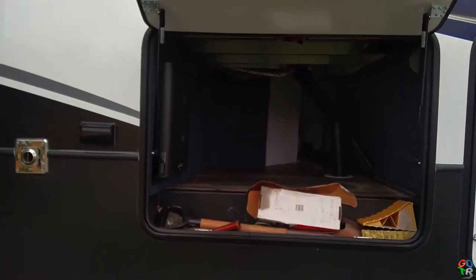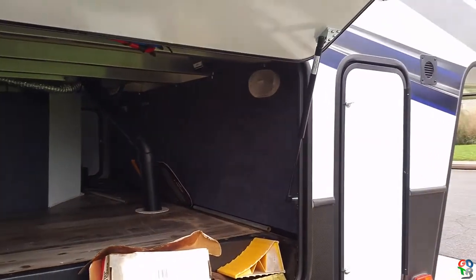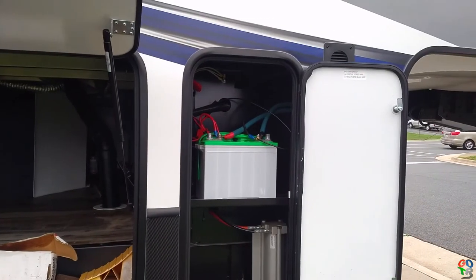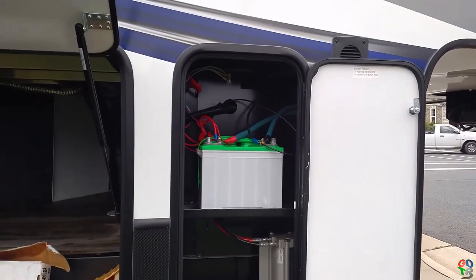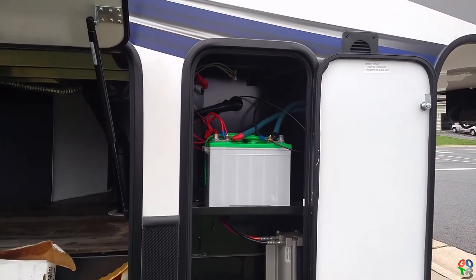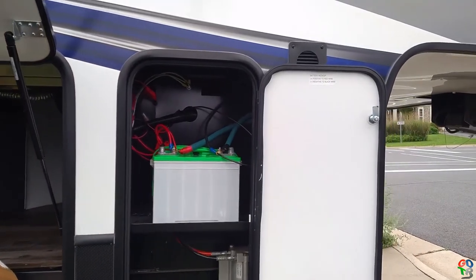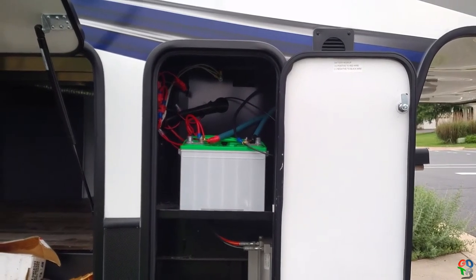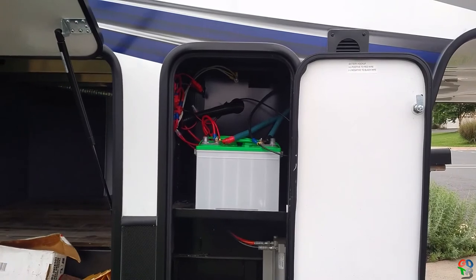You can see some gear in there — basically items like hammers, saws, axes, shovels, stuff you need to terraform things. There's your battery compartment — it's big enough for two Group 31 batteries. I've got them working out with Interstate right now. Generally you like to have all your batteries be the same manufacture date so they're easier to balance.